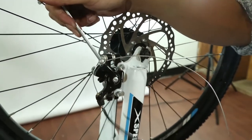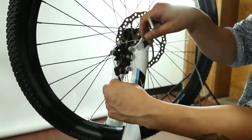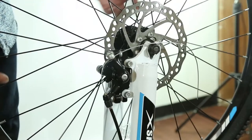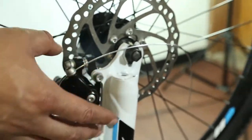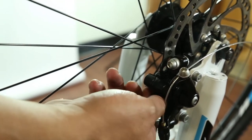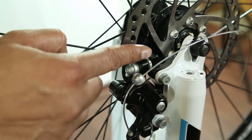You may need to adjust a few parts in the brakes. Check if the brakes are nice and tight. If they're not, loosen back up and tighten or loosen as needed. If it's too tight, you can either loosen this side or the other side with an allen wrench to loosen the brake. You can also reset it by pressing down on these little flaps. If the caliper is tilted to one side, loosen it and rotate or move it back and forth to get it right, then tighten everything back up.